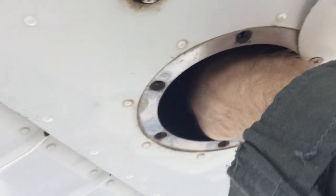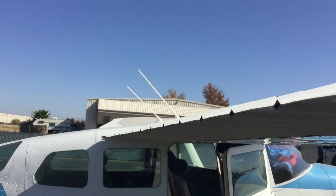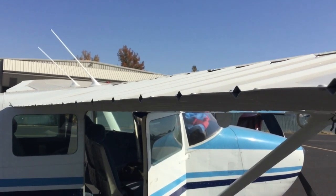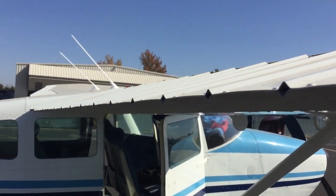Up in this hole here in the right wing, we've got the aileron crossover cable, and I can tell just by touching it that it's loose. If I reach up in here and simulate more tension on the cable, this right aileron will actually return back into the proper neutral position. So just doing that, I know things are not quite in rig.